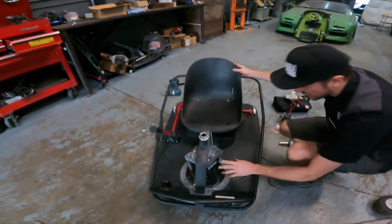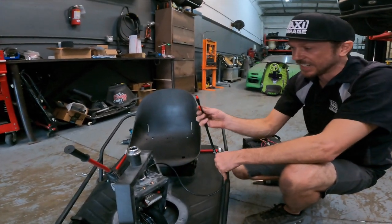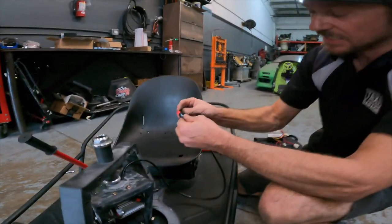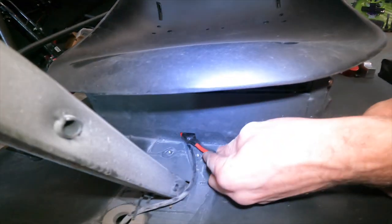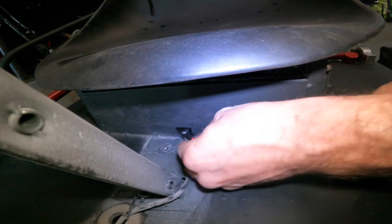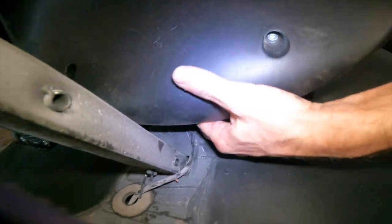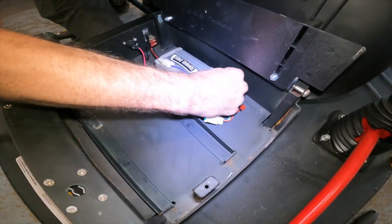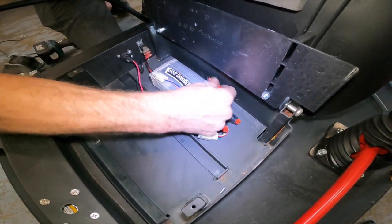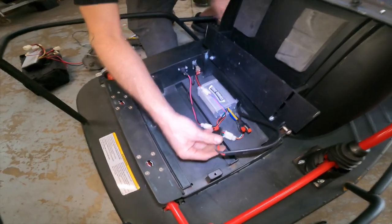So the motor is all installed. All of that's gravy. Now what you're gonna do is take the end that came pinned and simply slide it in the opening that is under the factory seat. So you can see it literally fits right in there, and you can open up the seat and grab it from the other side. You'll see it here in the video. It fits, no depinning necessary. Just a little bit of wiggling. Pick the seat up a bit and boom, you've got your harness through.